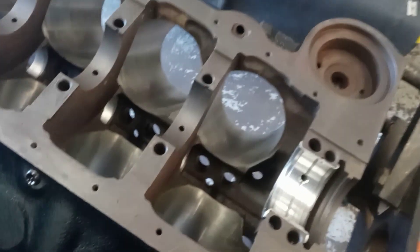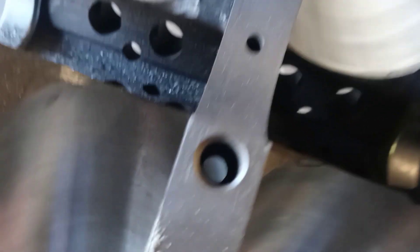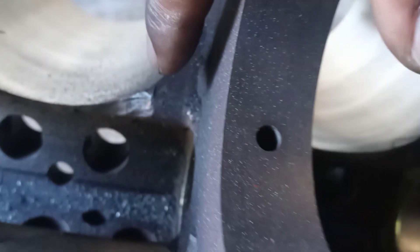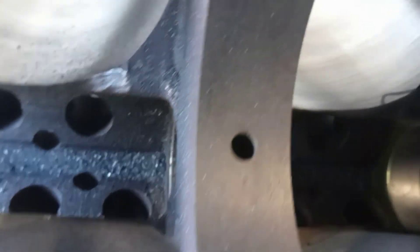I'm going to go ahead — all I use is a regular die grinding bit. I use a coarse bit to take some of the material away. First two cylinders, you can see right here. There we go — all this material here, we're taking it away. I took it away on this cylinder, which is number one on this side and two on the other side. As you can see right here, here's the marks on each cylinder of the material that we're going to remove.